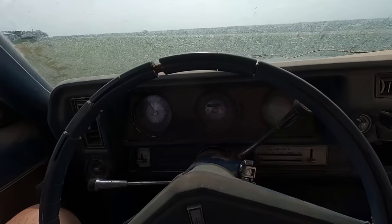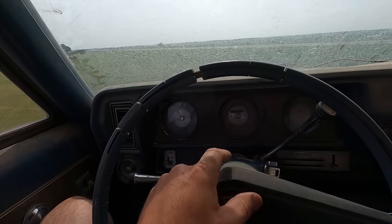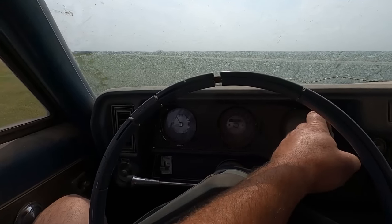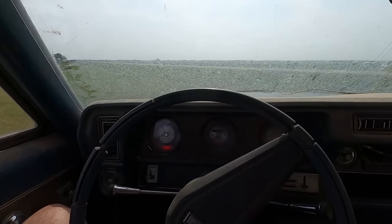I looked last night at Rock Auto. It's a 3505 starter, not a 3510 like a small block uses, so it's probably just the nose cone. We could swap the guts out of a small block, but we won't. Priorities. Let's get some better wheels on it.